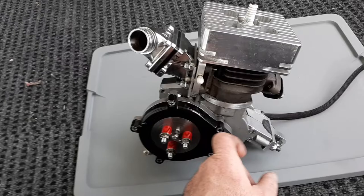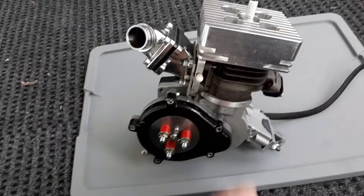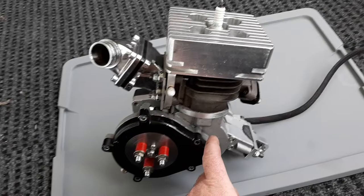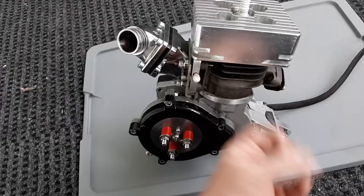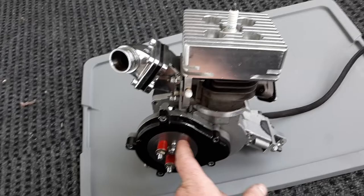I did that even on my first one and I realized the error of my way really quick. You want to make sure the seals are removed from those bearings, because the crank seals are gonna just disintegrate with the amount of RPM these have. They're not designed for this type of thing — you're gonna have to pull the seals off your bearings so that those get lubed. You are gonna lose those regardless because there's a lot more stuff happening to cause those to fail.